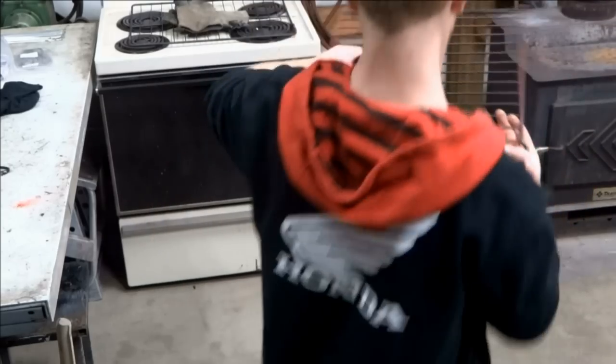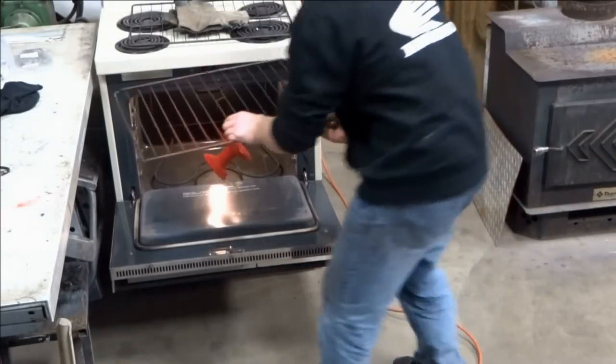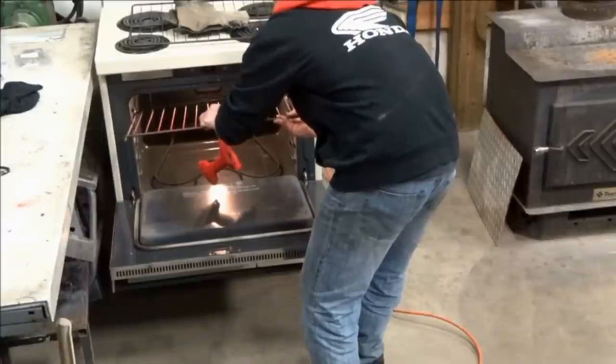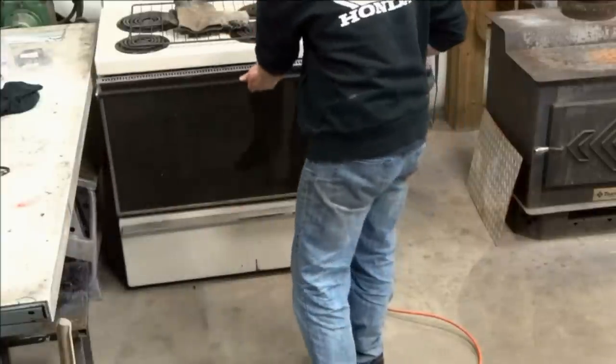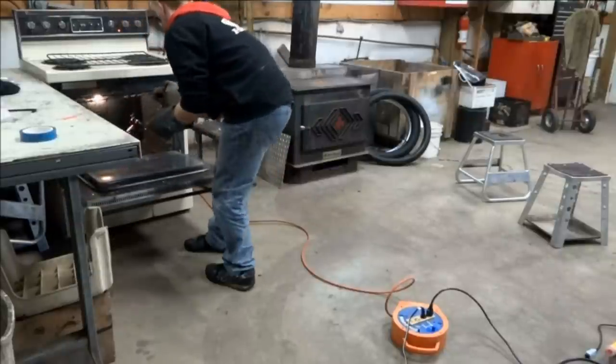Once you've thoroughly sprayed the part, you can put it in the oven for the recommended temperature and duration. The amount of time and the temperature you have the part in the oven is very important with this color. If it's too long or too hot, it might become a lot darker. Translucent colors are pretty hard to do, so if you notice that you missed a spot, you can always respray the translucent.